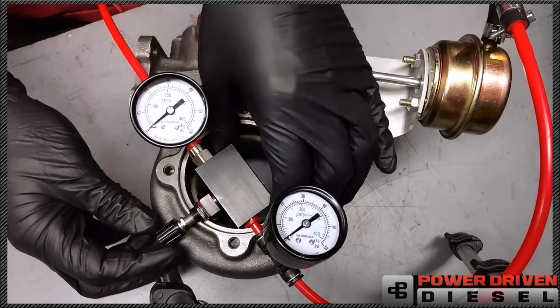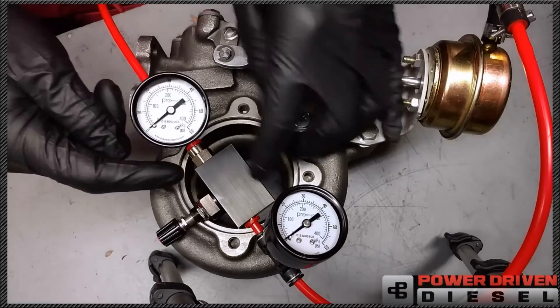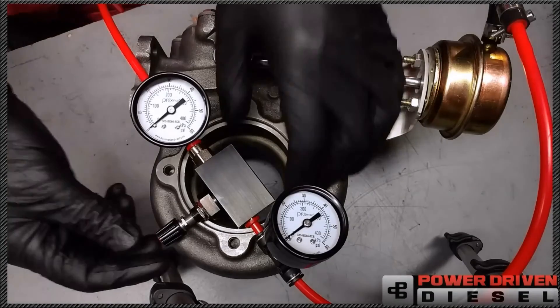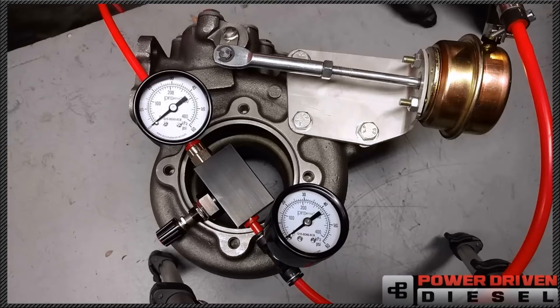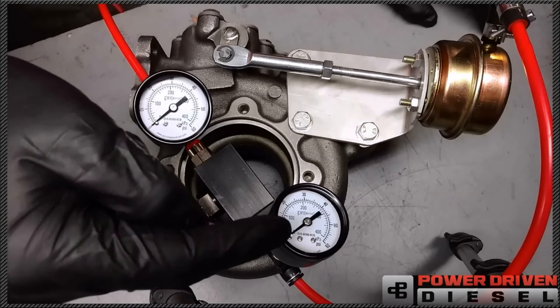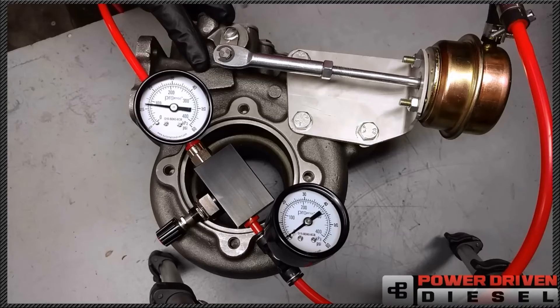So I'm going to adjust this. What this does is stop all boost from the turbocharger reaching the actuator housing side until our preset amount — whatever we decide that to be. I just did a few turns; we'll do some trial and error. This is going to stop the boost from getting through until a certain number, at which point it will let it through. Now we're at 5 psi — nothing through. 10 psi — nothing through. So we're going to have 10 pounds of boost and this thing has full closure. All the spring pressure is holding tight. Before this, we were already starting to lose drive pressure; right now we have not lost any. A little higher — there's 15. So about 14 psi is where it cracked.